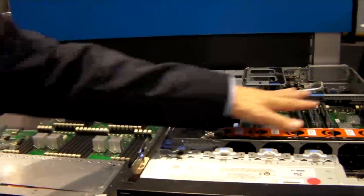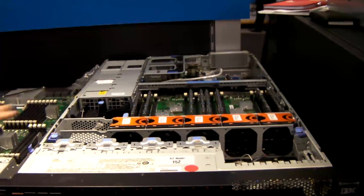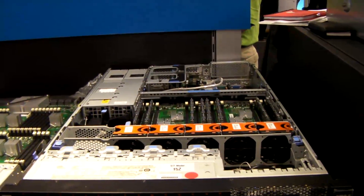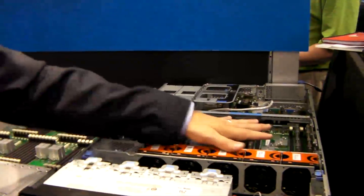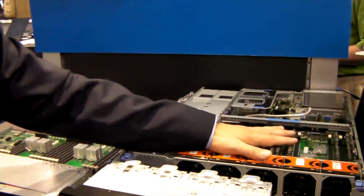From a bandwidth point of view, not only do you get fast memory, but you get access to a lot more DIMMs. You can have a 2-terabyte or 1-terabyte machine, but more importantly you can buy lower-cost DIMMs — maybe 2 or 4 gigabit memory DIMMs — and go very, very wide. Just like databases in years past where you really want bandwidth and lots of spindles, the same thing is happening in the memory subsystem. That's one of the main advantages of why we built the Max 5 — to give these systems great capacity internally and externally, and also the bandwidth attributes. More DIMMs means you're going to get access quicker to stuff, like having a lot of spindles in a big database.